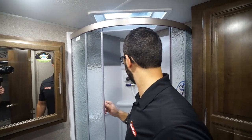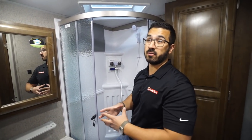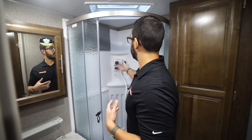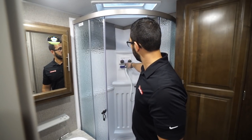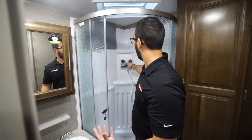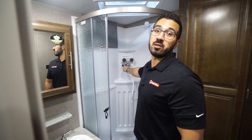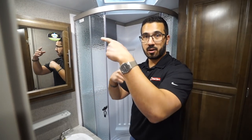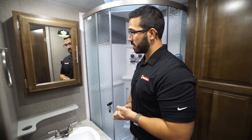You'll also see this little guy — they call it the Shower Miser system. This is really cool especially if you do a lot of boondocking or camping without water hookup. When you turn on the hot water it normally takes a while to cycle through the water heater, wasting water from your fresh tank. With the Shower Miser, it pipes water from the water heater back into your fresh water tank. This little elbow is blue, and when it turns clear that means your water is hot — then you flip the lever and you have hot water. Basically it re-circulates through your water heater back into the fresh tank so you're not wasting any water.